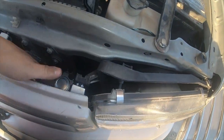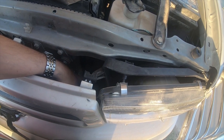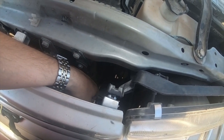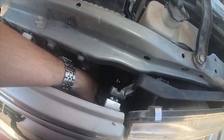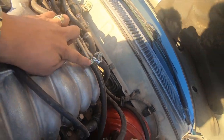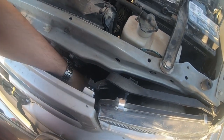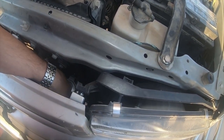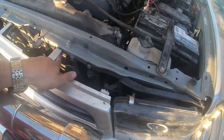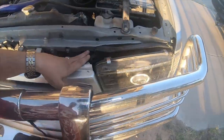I used a little quarter inch socket to turn and tighten the quarter inch twist-thread style bolt and clamp — gear clamps — to lock the rubber hose. Instead of using clear hose I used this rubber hose that I was showing you inside. That flat head screwdriver was to pop all these clips right here — as you guys know from the headlights video, all these clips are brand new.